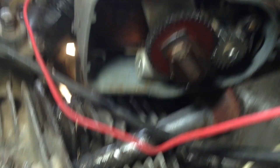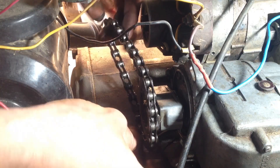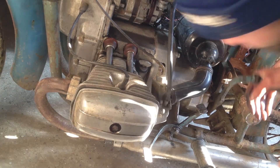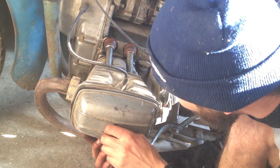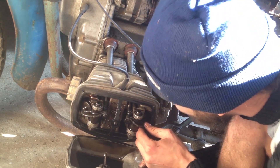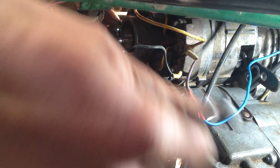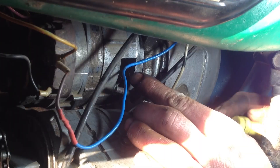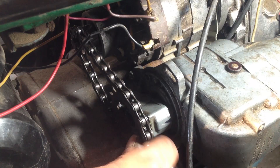So now I'm gonna try to guess at what point the rotor will be looking at one of the contacts — this will be the TDC. Now the most intricate part: setting up the ignition. The mark appeared and now I'll remove the cover to understand on which cylinder both valves are closed. Both valves are closed on the left cylinder, which means the wire that the rotor points to will go to this cylinder. We found the TDC, I have a mark here, I can tighten everything up and throw on the plug wires. Thanks to this rear mount, our chain got tightened. Seems that everything is ready.